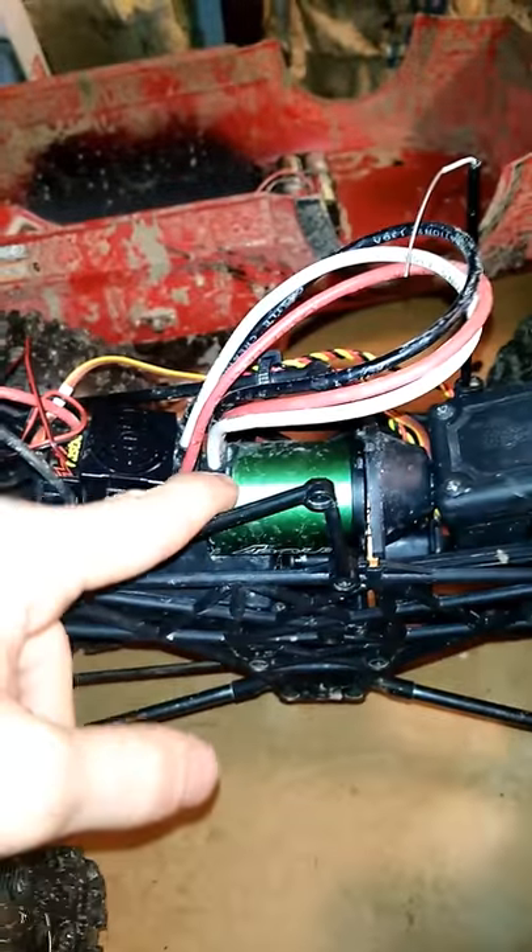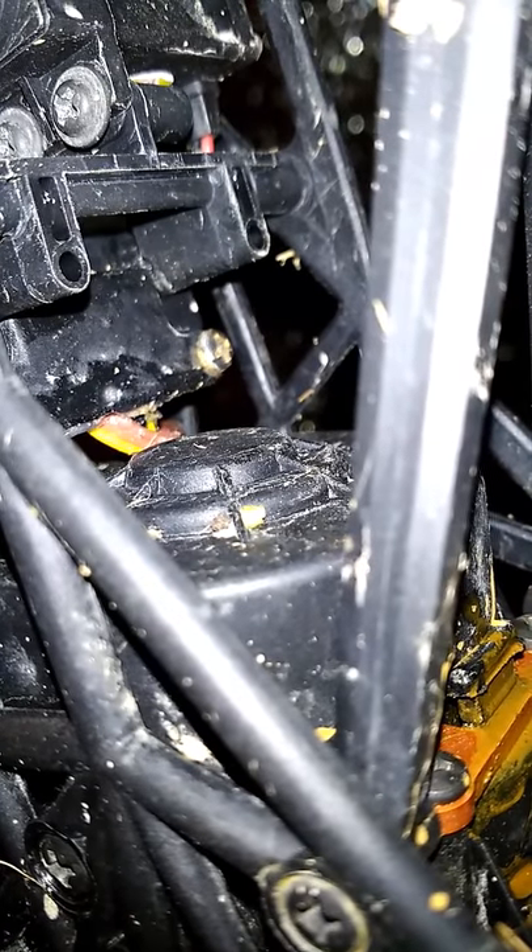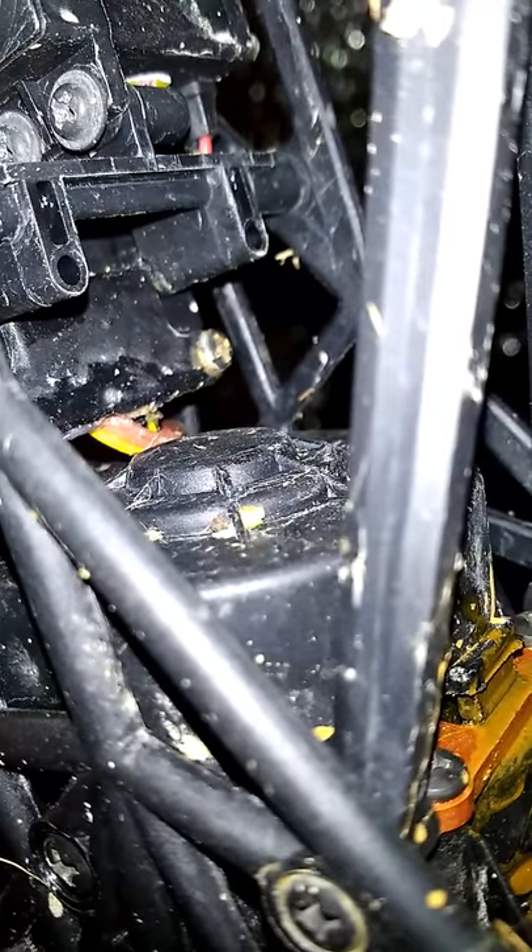What we do is put a little bit of silicone around the bottom crack of the ESC. On these receiver boxes it's got a seal, but what we usually do after we screw it is put a little bit of silicone right there on the bottom as well. If you can see, there's silicone right there — that's the only real spot where water comes in on the bottom if you're going through deep water.